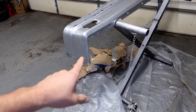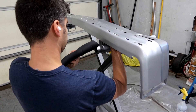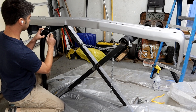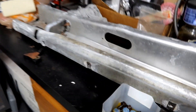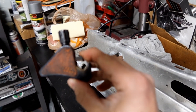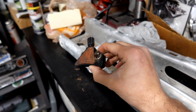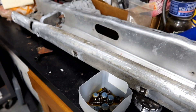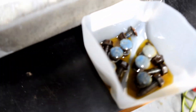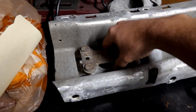We're going to let this dry. I bought some pipe insulation that I'm going to wrap my stand in so I can flip this thing over and start installing the inner bumper structure. While we wait for the bumper to dry — this little thread chaser I bought on Amazon is one of the most valuable tools I have in the shop. I'll try to leave a link in the description. We chased the threads on all of the fasteners for the bumper and went ahead and doused them in penetrating oil. Let those sit and soak overnight.